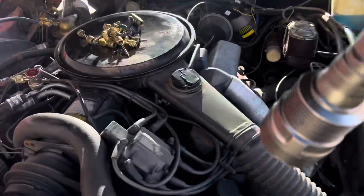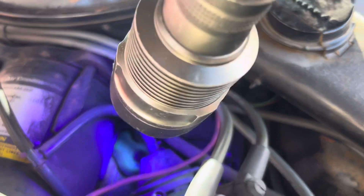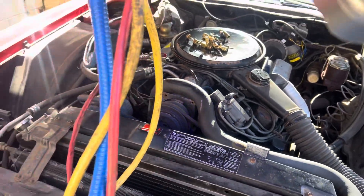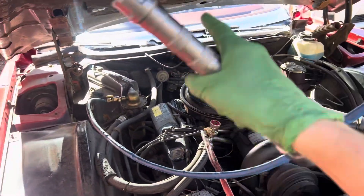Let's see — we see the glow down there, a little bit of glow. And that's coming off the back of the case, or the seals in the back. But I'm going to fill this up anyway, even though I know it has leaks, because I want to see if the automatic climate control still works.